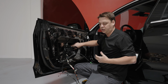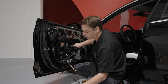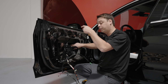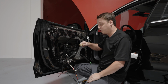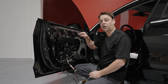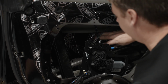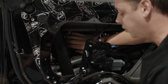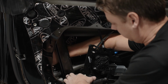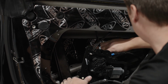Personally, I don't, because with a wooden roller or a rubber roller, it has sharp sides, and this is the outside of the car. So this panel here is in theory your painted panel on the outside. If you roller on this, you're gonna leave lines on your metalwork on the outside of the car. So I suggest just use your hand and just get it down the best you can. Like I said, you can go over with the roller lightly, that's your choice, but I wouldn't myself. As long as you get it flat and get most of the air out, you should be fine.